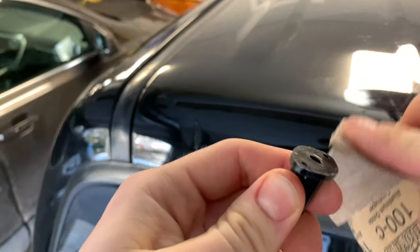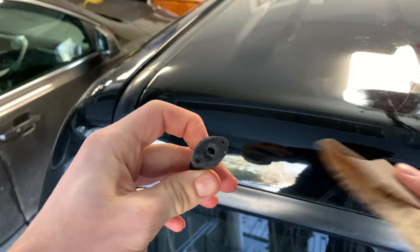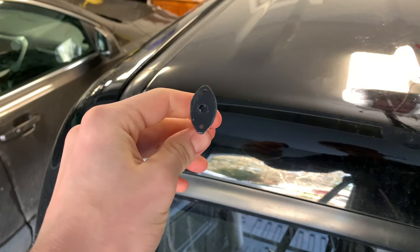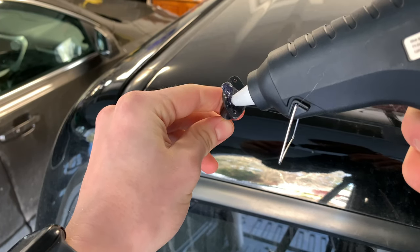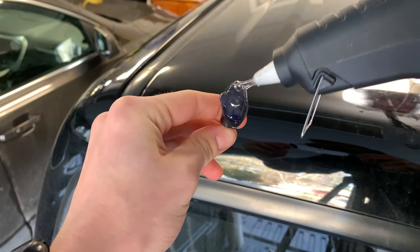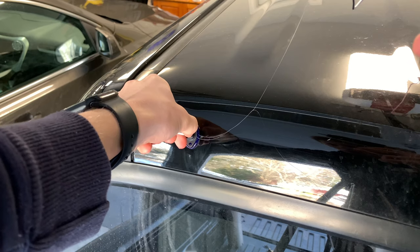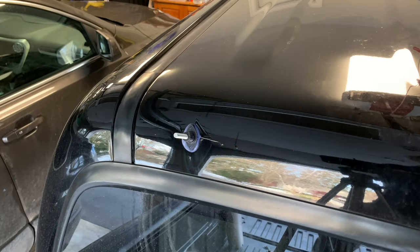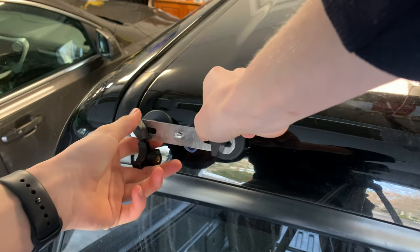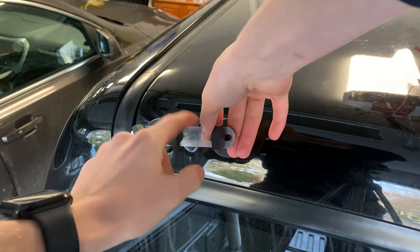While I was struggling to get that hot glue to really stick to both the pad and in the dent, I found it really helpful to take a little bit of sandpaper and scuff up that dent puller tab to make sure the hot glue would stick a little bit better. Then I put a whole ton more hot glue on just to make sure it would really stick and ooze out around and fill in that crevice in the dent. You kind of want to hold it and make sure it sets up a bit so it doesn't slide around. Then just the same process — screw on the dent puller contraption and start tightening it down until you hear a pop and the dent pulls out.